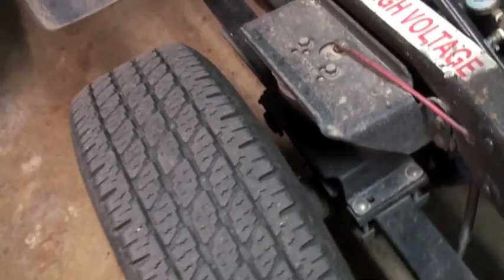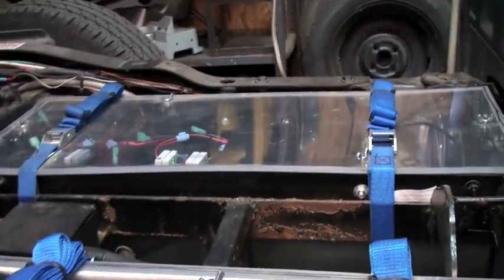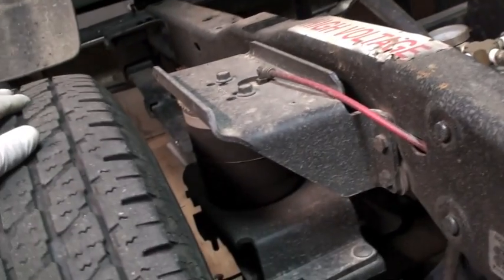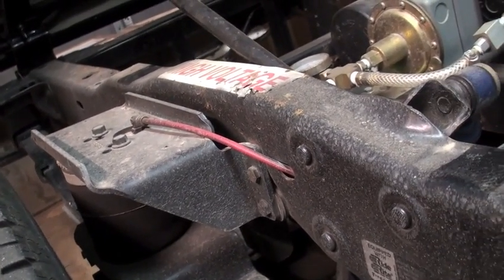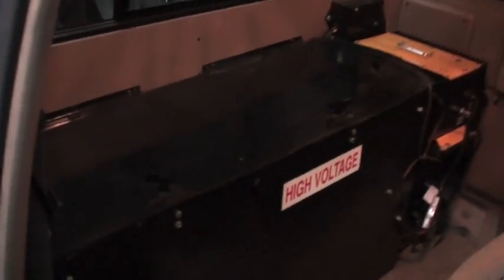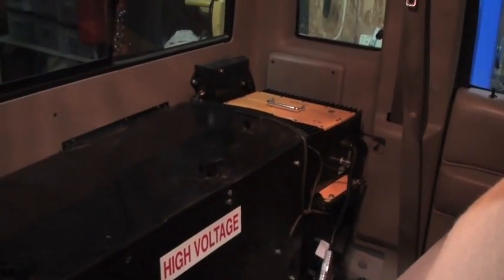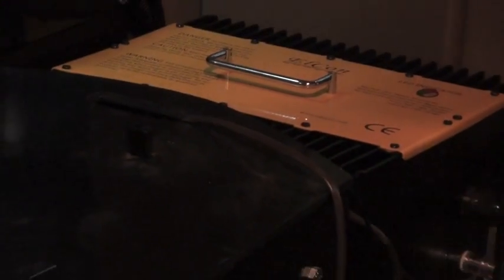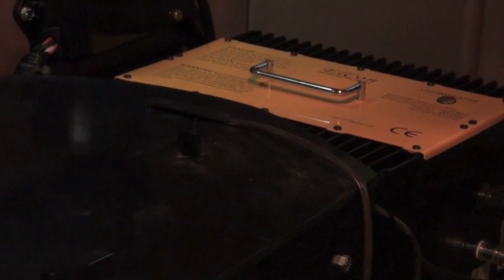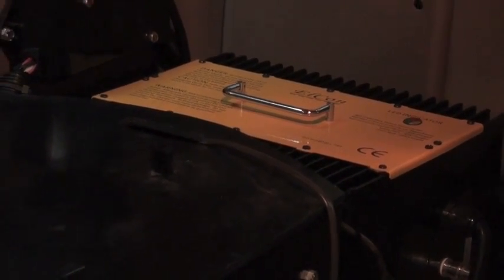I've got these air rides down here and I'll have to adjust them. Right now, even with just these five back here, I had the air rides almost completely off because there was just no weight in the back, and it still gave me a rough ride. So I'm going to have to do something about that. Now let's look inside the cab. This is where the inside battery boxes are and there are an additional five in here. There's also my charger unit over there — that's an Elcon unit set for 144 volts for these specific sealed lead acid batteries, 110 amp hour batteries.